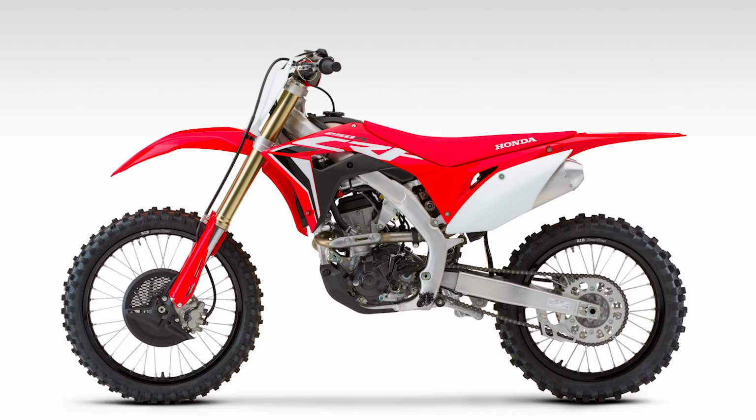They've optimized the combustion chamber shape, so they're actually tweaking the head design a little bit there. Ignition timing is optimized at 8,000 RPM for improved torque and power. Overall, they're actually changing the ignition mapping a lot because it gains the gear position sensor that the 450 got last year. So now it has dedicated ignition maps for all 5 gears, one for each position. Fuel mapping's the same, but ignition changes per gear.